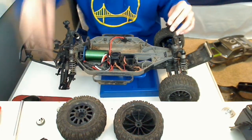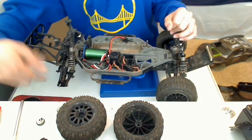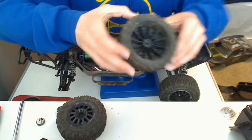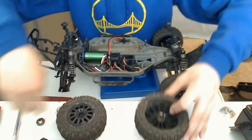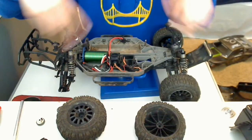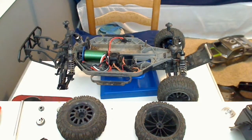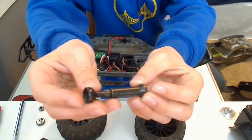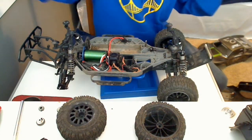That's very loose. The bearing in this rear hub carrier has blown out and left a massive amount of whatever was in it inside the hub carrier - it's not good. It actually kind of ruined the inner hex, and it's kind of destroyed in there. I have the STRC metal hex for the axles all around, and I'm just running stock axles because I had CVDs, but they didn't really work - they would just fall apart constantly. Little grub screws that held in the parts inside would just fall out constantly, and then they rushed it out and it wasn't very good.